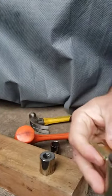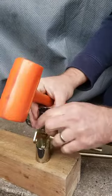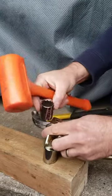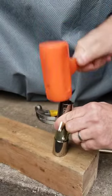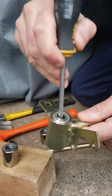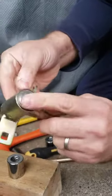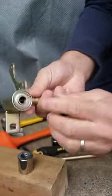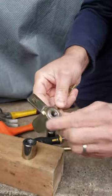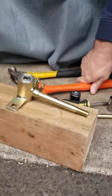Okay, now it's almost there. I'm going to check one more time if my spacer is sitting properly. Actually, I'm done. You can always move the spacer with a screwdriver inside to align it properly. This is it — you're good to go. This way you will not damage the smaller race, and you will be handling only the big one. And this is how you replace the bearings on your knuckle in a safe way.